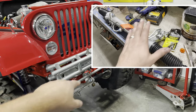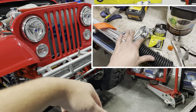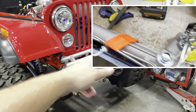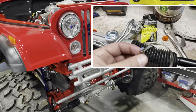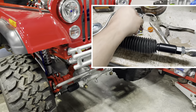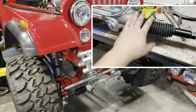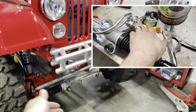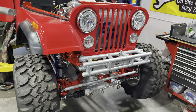The old rack and pinion — it was my fault. I switched the lines out and blew out the seals, so it was sending power steering fluid everywhere. I was hoping to get a seal to fix it but couldn't find any seals — I think that's some of this Chinese stuff these days. Anyway, got a brand new rack and pinion, got everything hooked up right, all working now.